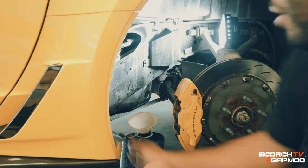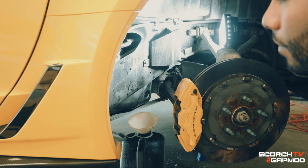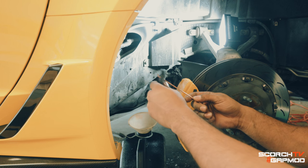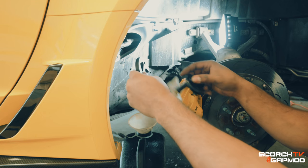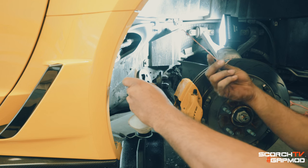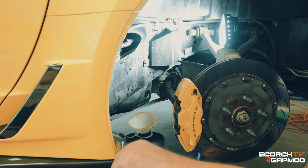As you can see, we cut the hole. It's a pretty thick fuel tank, which should be good. We're going to go ahead and install the CNC bracket that goes on the inside. Once we get that in, we'll fill this in without knocking it off, then rotate it while still pressing up against the back, sticking a small tool in to hold it in place while we tighten it up. Stay tuned and we'll see how that goes.